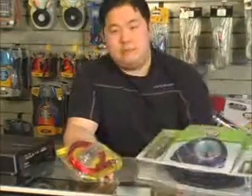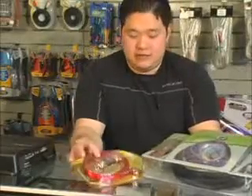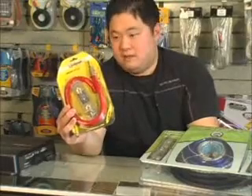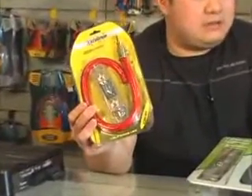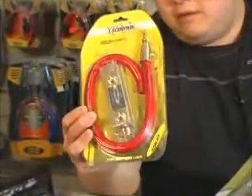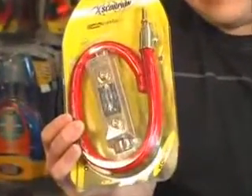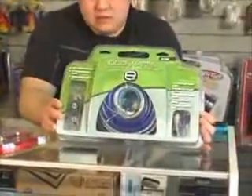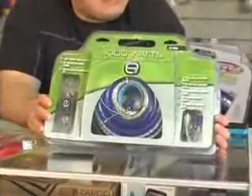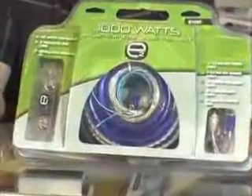The average amp wiring size you're going to see is between eight gauge and aught gauge. This is aught gauge — this is huge, a big daddy beast of wire size. This is for amplifiers that are 800 watts and up, but more than likely you'll see this on a 2000-watt or multi-amp big boss type of setup. This kit is a four gauge kit, and four gauge is usually good for almost every application from 500 to 2000 watts for a single amplifier, but a lot of people like to step up to aught gauge once they get past that 1500 RMS mark.